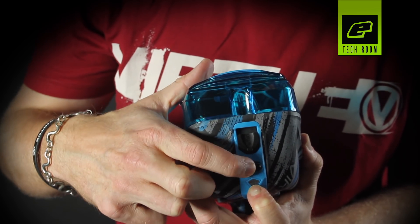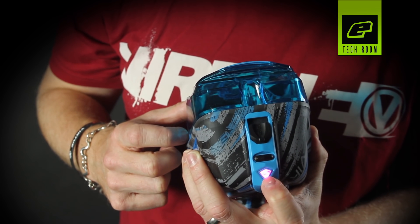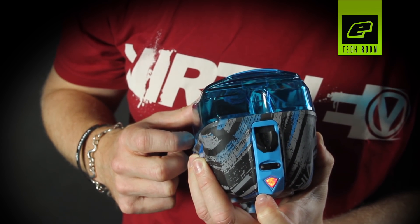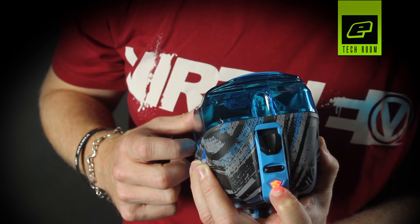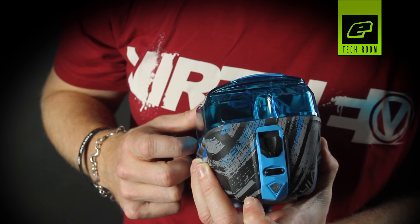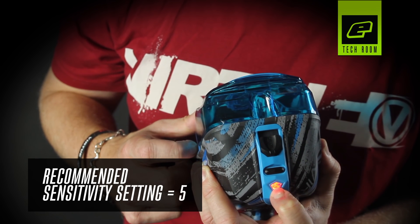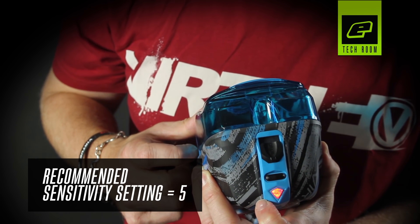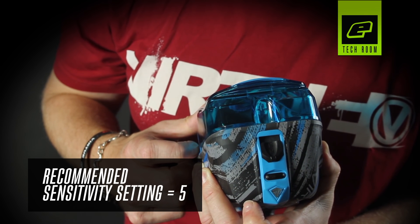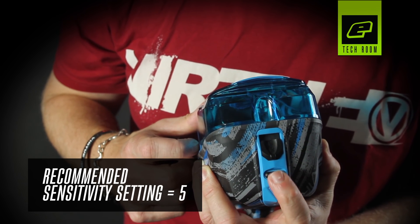Push and hold the LED cover, push the power button, release the cover and the purple light will show. Push the cover until the red light shows — that's the G-Force sensitivity setting. Push and hold until the light goes out, count the flashes, and that's the stock setting of four. If you need to raise the sensitivity, push and hold until the light goes out again, let it cycle through and click one, two, three, four, five times. Wait until it returns to normal and you're good to go.